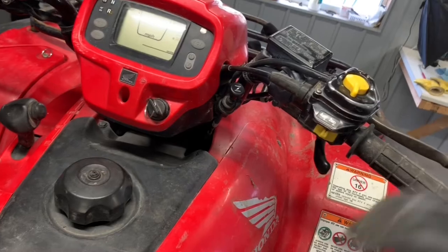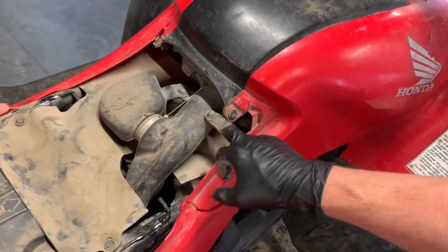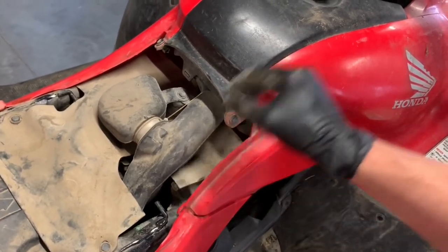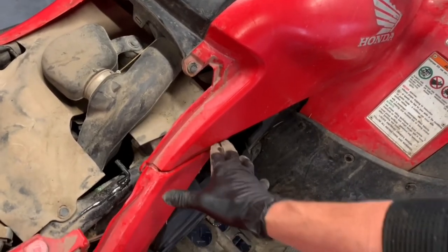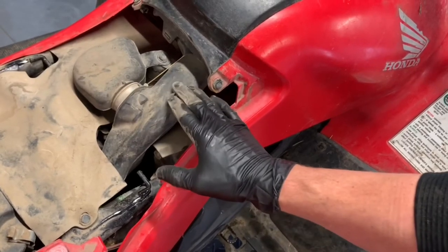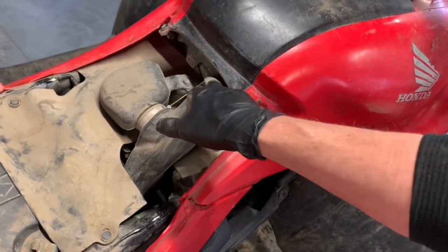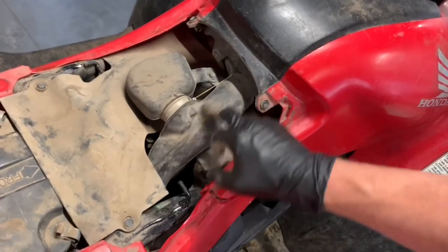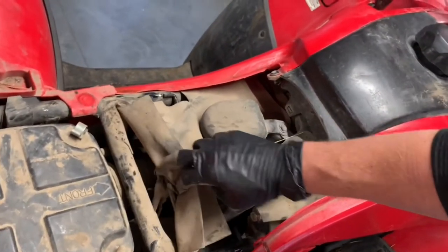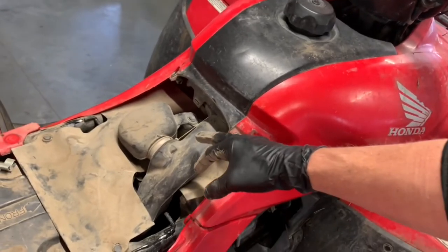If you're driving through some serious water, you've got an air duct that runs all the way up to here. They want that intake up high because if water is flowing through your footwell, the water is not going to touch this air duct. You do not want to drive through water that's going to be higher than this air duct, because this air duct goes right into your air filter — then your carburetor, right underneath this flap, is going to get loaded up with water. Make sure that you're not going through water up to that level.